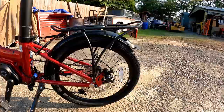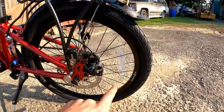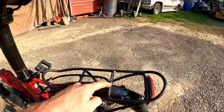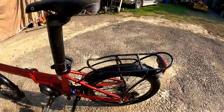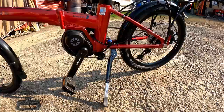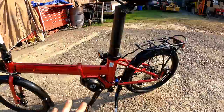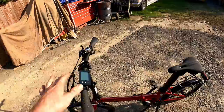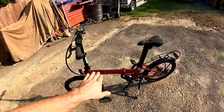Let's go over a few of the other features. We do have disc brakes on the front and rear — they're cable actuated Tektro Ares. The rear rack is nice and sturdy, made out of aluminum with a max load of 10 kilograms, about 22 pounds. The kickstand is also aluminum and it's adjustable. The mid motor is 200 watts, which they advertise gives a top speed of 20 miles an hour. It doesn't have a throttle — no twist throttle or anything. It's only pedal assist, and they do have five modes for that.